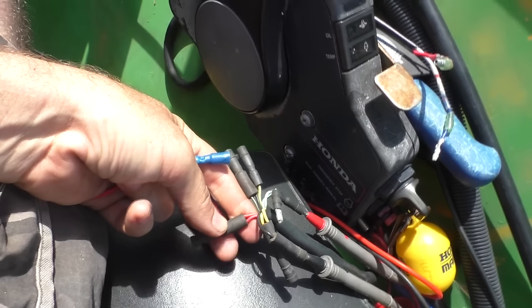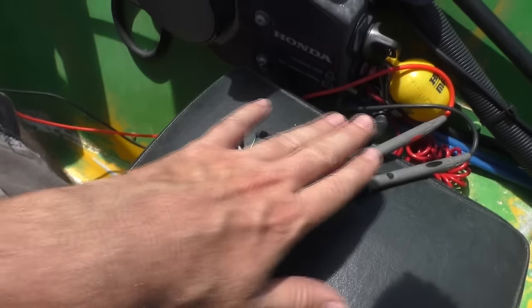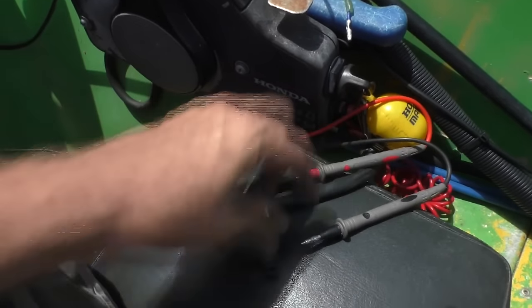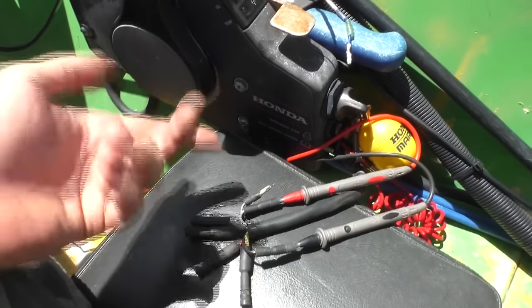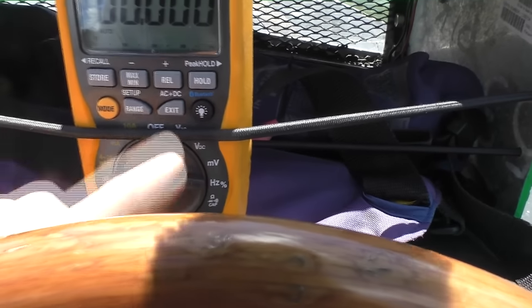I'm now out on the water to calibrate this tachometer. I wasn't getting power out of the forward controls from the red lead, so instead of troubleshooting the ignition switch wire I've run direct power from under the dash from the positive bus — I'll sort that out later. I've got the tachometer unplugged and I'm using a multimeter for calibration. The gray signal wire from the stator coil goes to the positive lead; the multimeter probes plug straight into the bullet connectors. Negative goes to earth and the multimeter is set to hertz, so we're looking for a frequency.